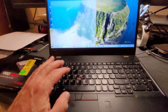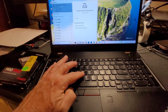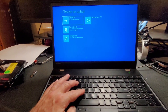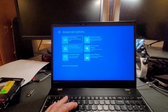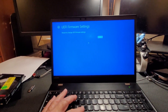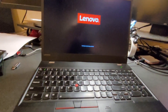What we're going to do first is come down here, type BIOS — you can type 'setup' or 'reset' — and hit restart now. Click on Troubleshoot PC, Advanced Options, and UEFI Firmware Settings, which is similar to BIOS but a little more advanced. Hit restart, and on the Lenovo I have to be ready to hit Enter to go into setup mode.